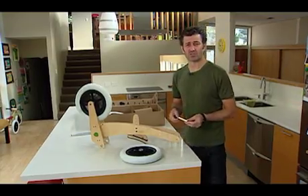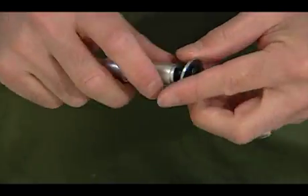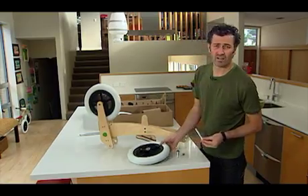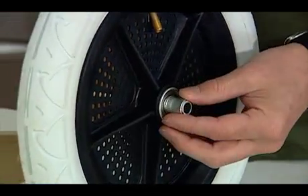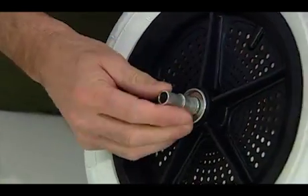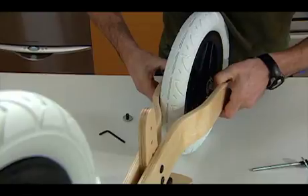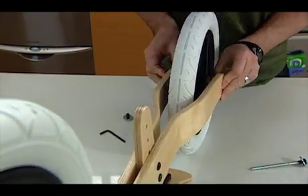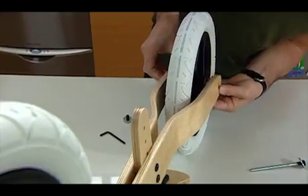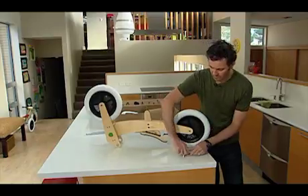Now we're going to do the two-wheel version. I'm going to pull out the rear bike axle so we can see the various components. Like we did with the trike axle, the best thing to do is place the axle through the centre so you've got an aluminium spacer on each side. One thing we're going to have to do here is splay the rear frame parts apart so that we can drop that into place. Once you've stretched that open and lined up the holes, you'll see that you've got the axle penetrating through the wood on both sides.